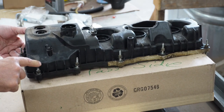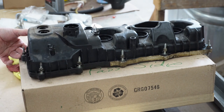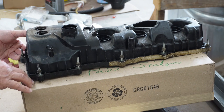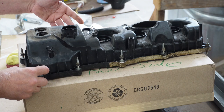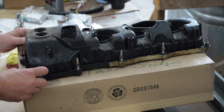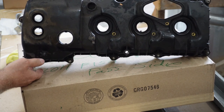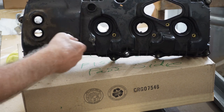This right here was difficult. The reason is it had a bracket on it that went down to the alternator. I couldn't get any movement out of that bracket, so I had to loosen the bracket on the alternator. You've got to reach in around it, loosen it, and then I could get in here with a pry bar and get this loose to get to this bolt. There's a nut on either this one or this one you've got to take off — the bracket will come right off. Then just go around and pull the screws out. You do have to get inside these ports right here and break these loose with a flat screwdriver, getting down in there without touching the tube, and give it a good solid whack. It breaks that rubber loose around there.